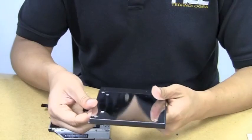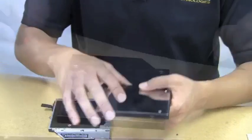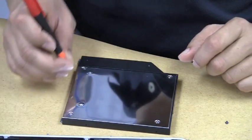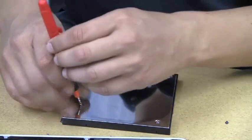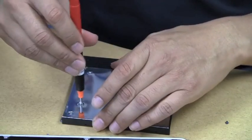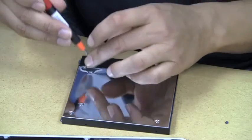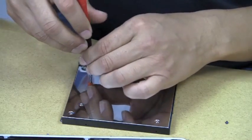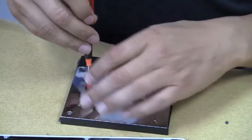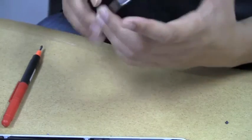On the bottom there's a place to attach two screws that are provided. We'll attach the screws to the bottom of the OptiBay now — this adheres the drive itself into the OptiBay. You're securing the drive so it's not just held by the connector — it's a totally secure fit. There's no looseness and no vibration.